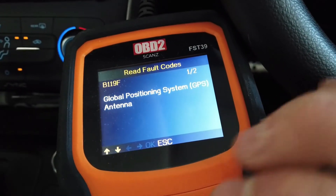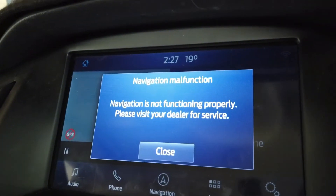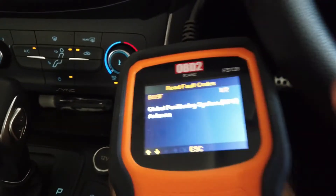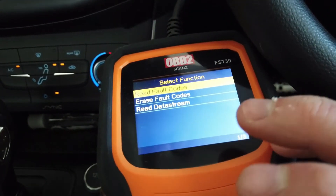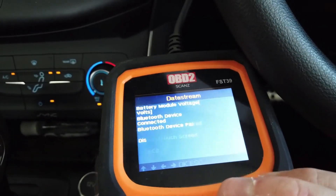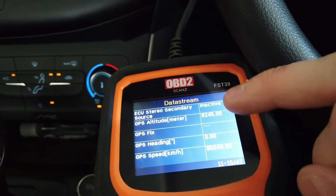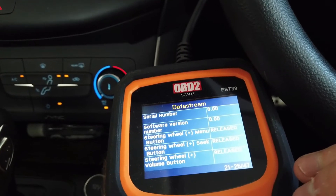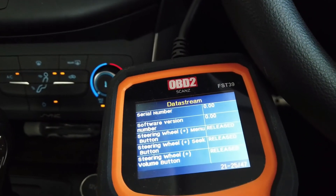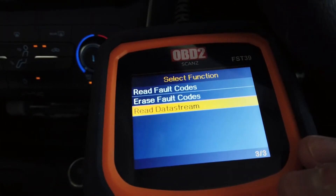It's picking up a fault on this car with the GPS for the navigation, which you can see is correct because it's giving us that same fault on the media unit. So that's the first step showing why these are handy — you can scan and read faults from all modules. In that same module you can also pick up all your data. There are 47 data points coming in — you can see as I push the volume button it picks up that data point. So you can see all your data streams from all these different modules.